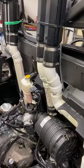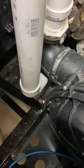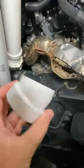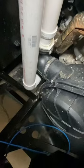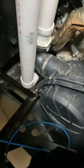Pretty simple. One thing I forgot to mention back over here on the bottom belt drive fitting: I needed to add just a little bit of length to that. So I cut one side off one of these double female 22.5 degree fittings and just connected it with a 1.5 inch long piece of 2-inch pipe, and that fits perfectly inside the rubber boot.